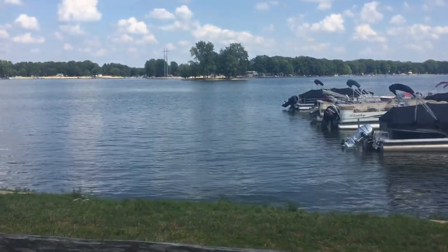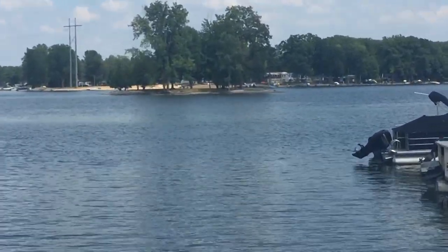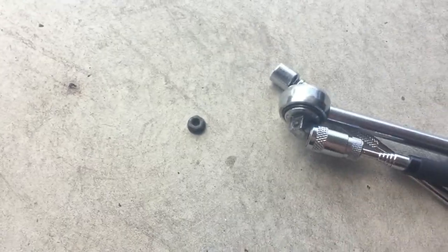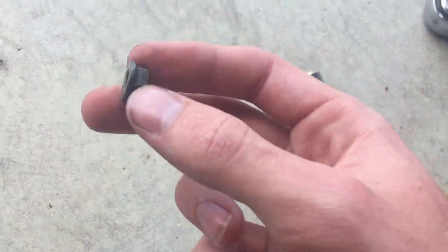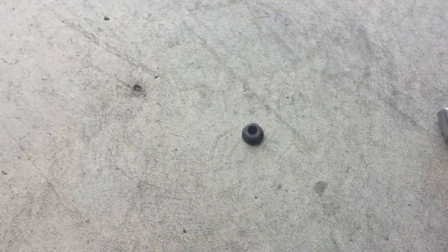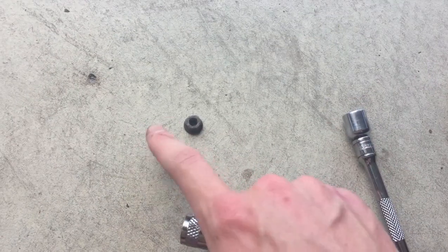There's that lake and the island out there. It's pretty small but it's fun, it's actually shrunk down quite a bit. Alright, so now the goal is to figure out the fuel problem. I'm going to use this nut for the fuel rail to tighten it down, because the other one's stripped. I think that's one of the problems — that it's not tightened down enough — so I'll put this one on first.